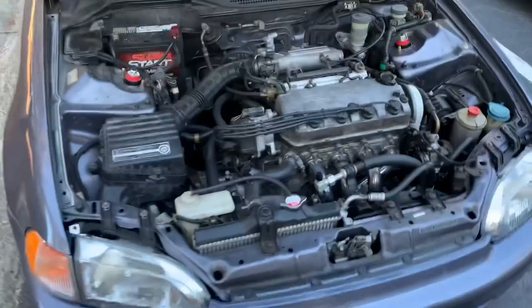I'm not too sure this video is gonna turn out to anything. Me and little girl, we just got home from work, and when I pulled into the parking lot, put my car in neutral, we were just sitting there, and it was just idling up and down, up and down. And I raised the hood and let it cool down for a second. I'm pretty sure it's gonna be my IAC, idle air control valve.